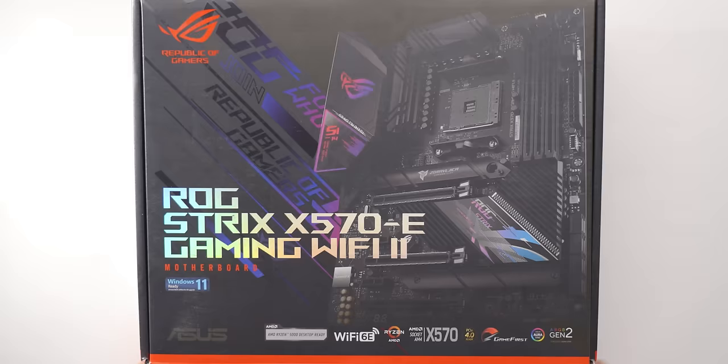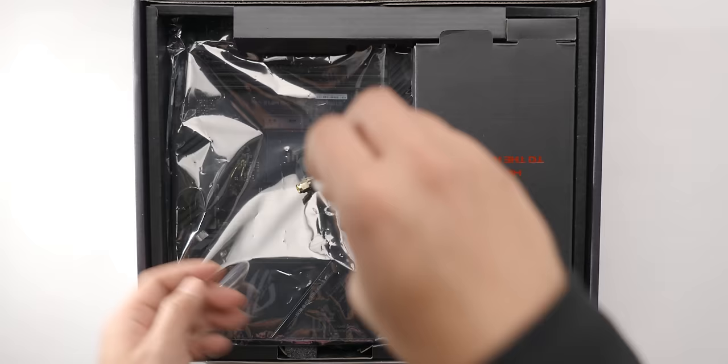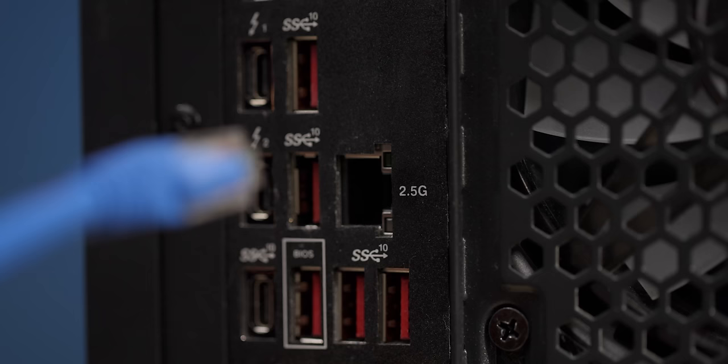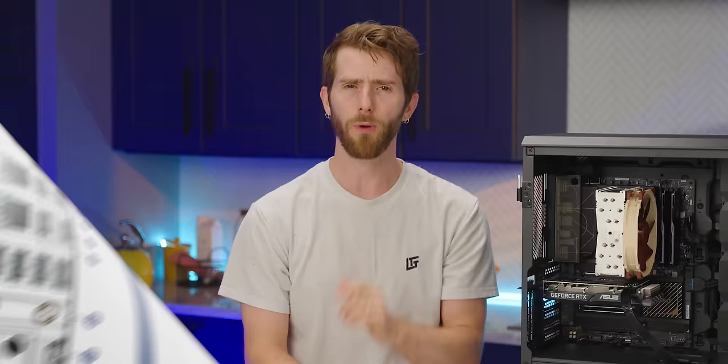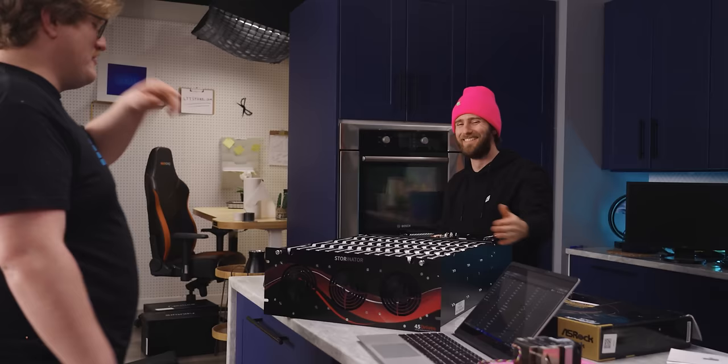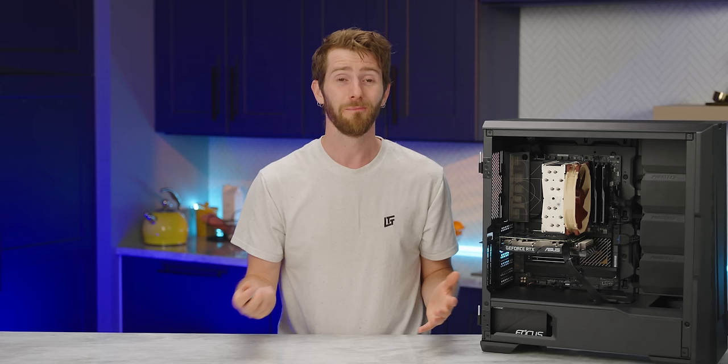If you're using a desktop with built-in Wi-Fi and Bluetooth and you intend to use it, please make sure you screw in your antennas. Unlike laptops, desktops often don't have integrated antennas, and while you might be able to see nearby networks, you will almost certainly struggle to stay connected. For wired ethernet, you'll often have one place to plug it in. But if you have multiple ports, check your motherboard's manual — sometimes they're interchangeable, but one might use a multi-gig controller that's faster yet requires additional drivers once you're booted into Windows. These multi-gig ports can be a huge boon for creatives, storage enthusiasts with NAS devices, or gamers with high-speed internet plans, but on a typical gigabit network they'll be limited to gigabit speeds anyway.